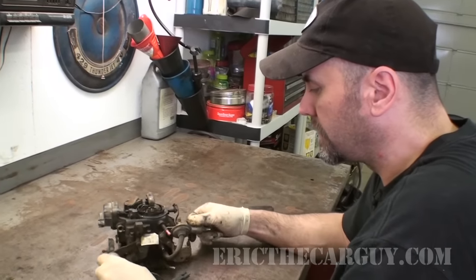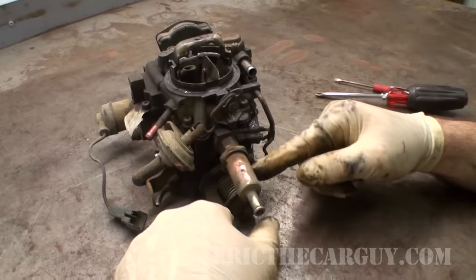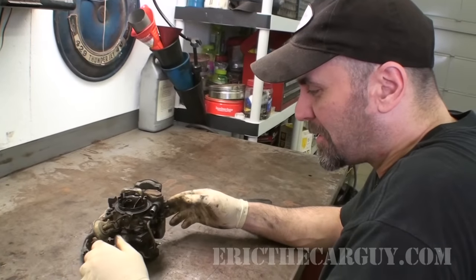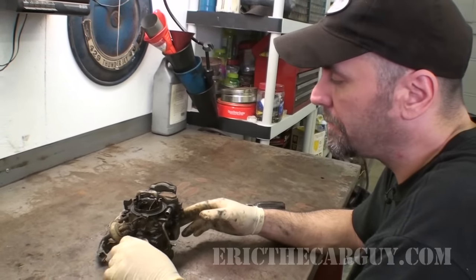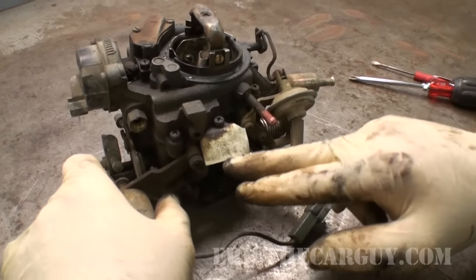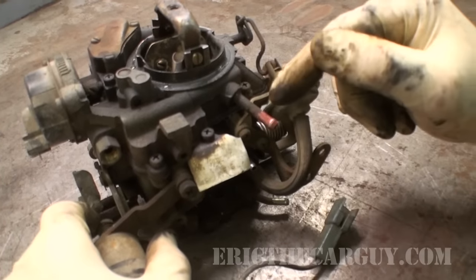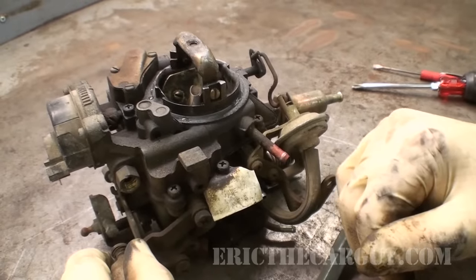Now that we have this off the car — the fuel filter was what was leaking gasoline. It looks a little bit bent around the seam, so that's the cause of the fuel leak. I actually like rebuilding carburetors. I bought myself a kit for about $20, and I also got a new float for about $20, so I've probably got about $40 into this rebuild. Also really important is this tag on the carburetor — hopefully yours still has one. This identifies the type of carburetor so you can purchase the correct kit.